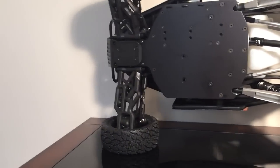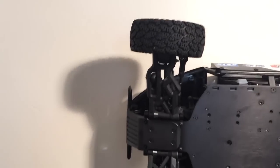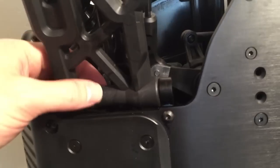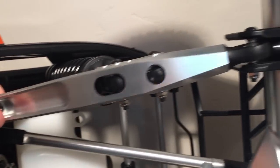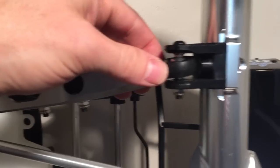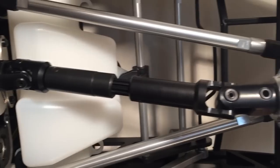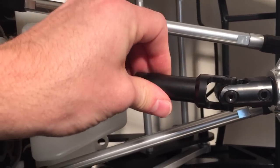Alright, so there you can get a good view of the underside. You can see the arms — these arms have 8mm hinge pins. And then these blocks in the front and the back are captured, so the hinge pins don't come out. That just makes it a lot stronger. You can see it's got really good webbing all the way through, which will also increase its strength. As we move back to the solid rear axle and the trailing arms, you can see they pivot nicely. It's got these huge joints that are not going anywhere. And then the telescoping rear drive shaft feeding into the axle housing is just another work of art — it's nice, it's tight, and it doesn't have a lot of slop. It's just a good design with a nice big solid plate that runs all the way up.